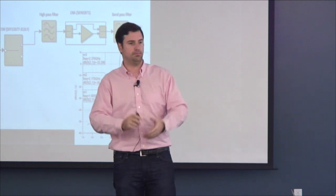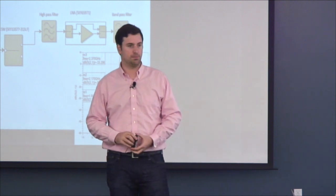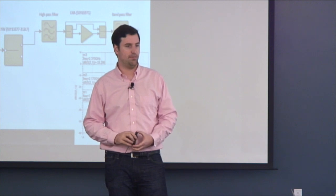This is not specifically for the outdoor AP — we have similar filtering on the AP225 indoors. We can put a 225 next to a DAS system about a foot and a half away and not see any impact at all. We're finding people are putting these things closer and closer together and there's more and more DAS, which can significantly impact performance if you don't have this shielding. With older APs like the AP105, we'd say more in the range of 15–20 feet. This feature is in the AP225, AP115, and the outdoor 275. Pretty much all the current generation — the ones with the nice shiny white covers — have advanced cellular coexistence.